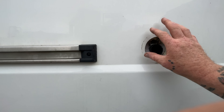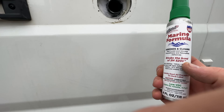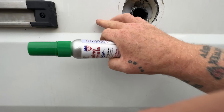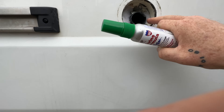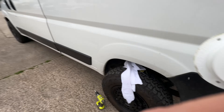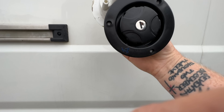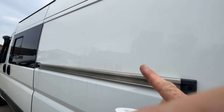What I'm doing here is literally taking out the old water filler point. I've just debonded this with some marine debond agent to take all the old sticker flecks off. Again, this is all going to be sanded, cleaned back, and painted with Raptor anyway. I'm going to clean up inside here, reseal it, and I've got a new water filler point - out with the old and in with the new, going black.